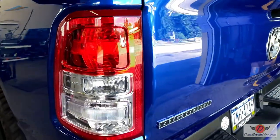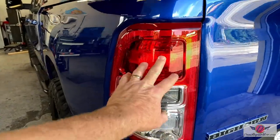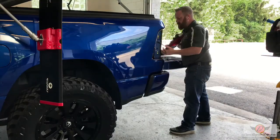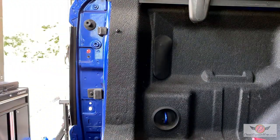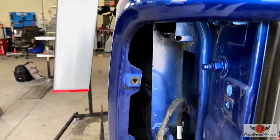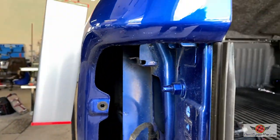We're going to get access by removing the taillight. In fact, I'm going to shoot a separate little video on how to remove the taillight on your Ram, so stick around and check it out. And let me show you why we took this out — that is to gain access to repair this dent up here. We're going to be able to sneak in right through there and work the back side of the panel.